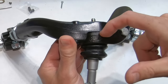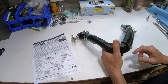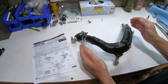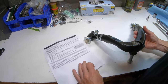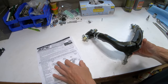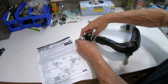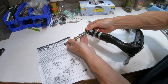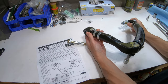They note in the instructions to make sure there's no gap once it's assembled and when you put it on the car. There is a pinch bolt on the forward facing arm that'll allow you to lock in the degrees of your two arms — when this is loose you can tweak it to get the fit and mount to your vehicle, then it needs to be tightened up. The specs are all on the sheet that comes with the SPC control arm. It has new bolts to mount it so you're not going to use your factory eccentric bolts, plus a spacer and some really thick heavy duty washers. I really like that it has Delrin bushings and no heim joints on this piece.